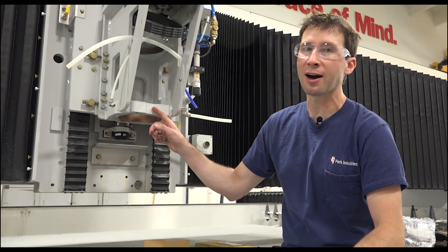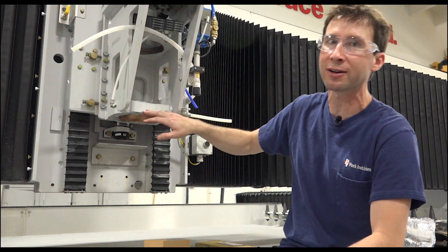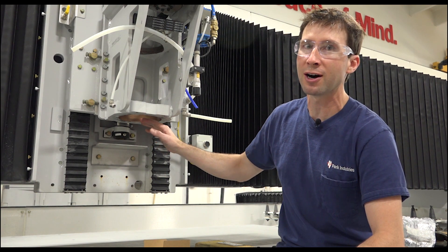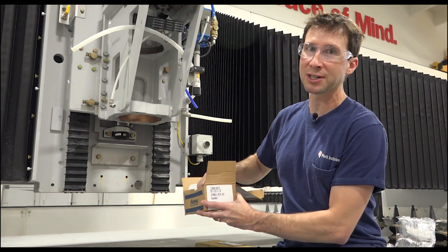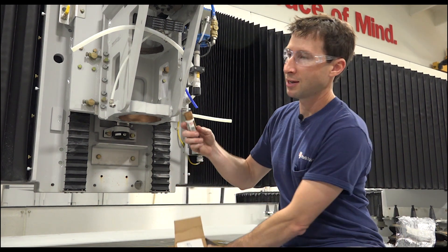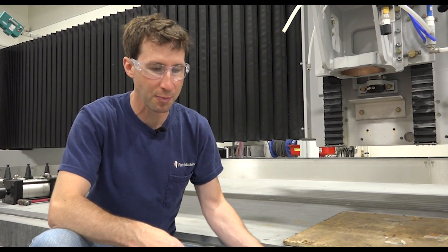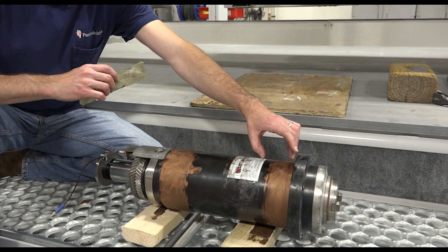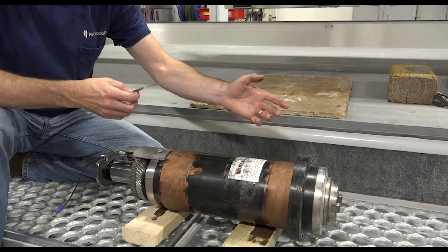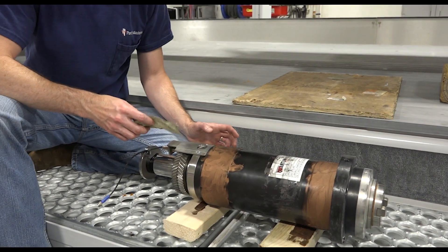The first thing is to clean these collars. When the old spindle came out there's going to be a lot of old anti-seize in the upper and lower collar, so you just want to clean that area really well. I already cleaned that up and applied anti-seize from the spindle replacement kit to the lower and upper collar. I've also applied anti-seize to these two diameters on the new spindle — you really can't have too much, so the more the better.